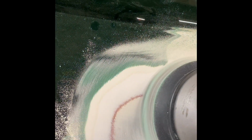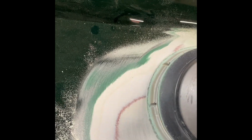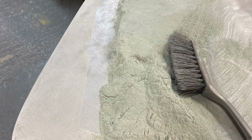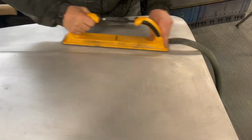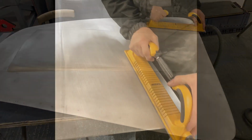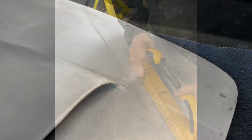The material on the bonnet needed to come off because there was some corrosion on there, along with the doors, so they've been taken back to bare metal. There's just too much material on the bonnet, an excessive amount of filler, so that's all coming off. Now we're going to be long blocking the bonnet, boot and doors to reveal any low areas, and there really didn't amount to an awful lot, just a fine skim here and there.